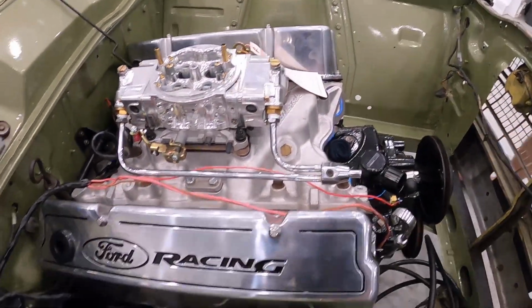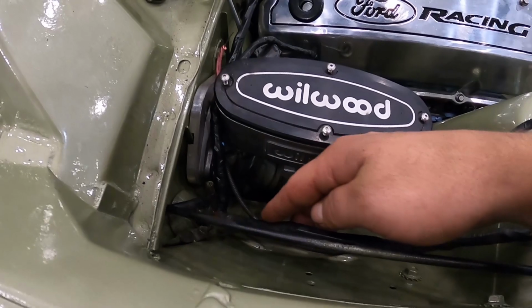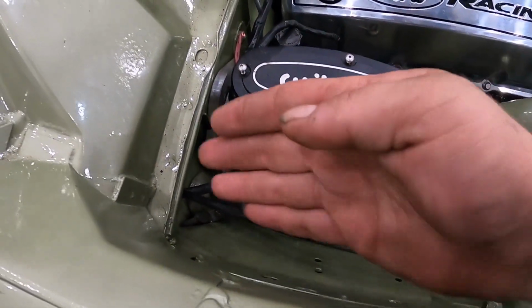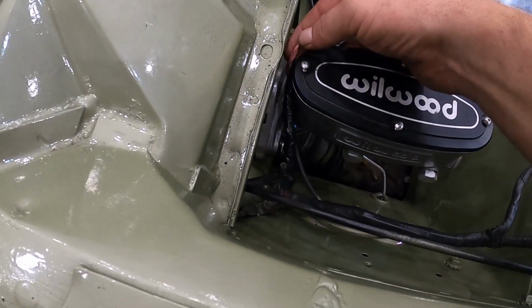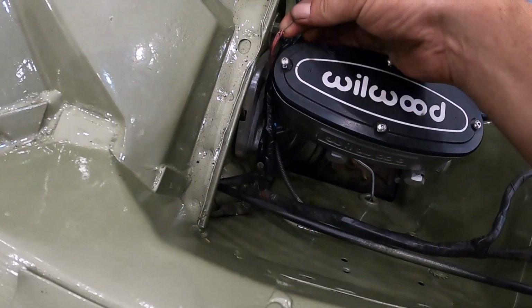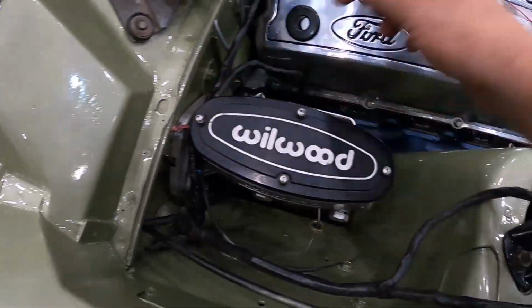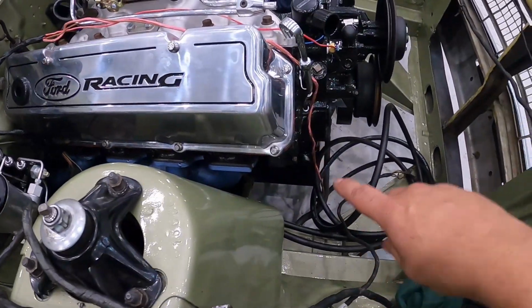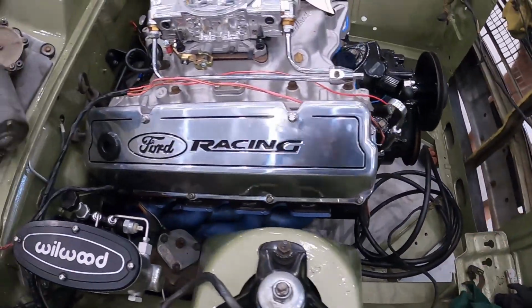Very lucky here, guys. When we came through, we had to pull the loom apart and do a bit of a rest, so there was a lot of damage over here. A lot of wires rubbed from the loom being pulled in and out of the car previously. We're going to be fitting ice ignition, so we've tracked the resistor wire quite far back. I'm probably going to delete that out of the loom, or we might go the other way and hook a relay up onto the end so that the ice gets full voltage.